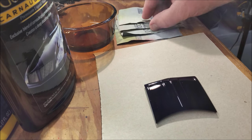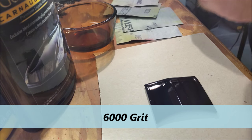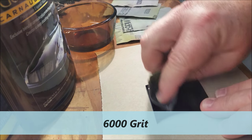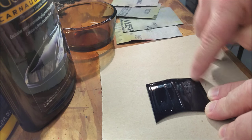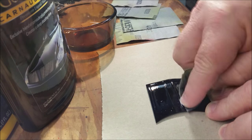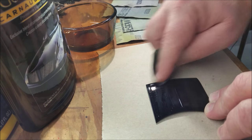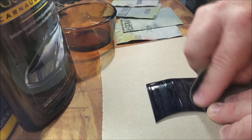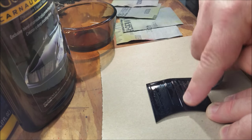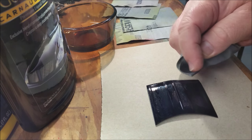Let's go ahead and get started — let's try the 6000 grit first. What I do is I dip it in a little bit of water and then we're going to get started sanding it with 6000 right now. Now you want to stay away from these high ridges. On this hood there's a high ridge with some curves and indentations. So we want to not press so much on those areas — we just want to try to scuff this up to get the little fallout pieces, lint, or dust. Stay away from the sharp corners and edges. Let me rough this up and we'll be right back.